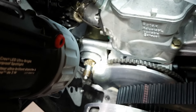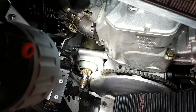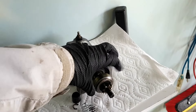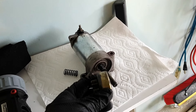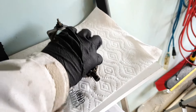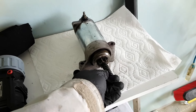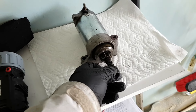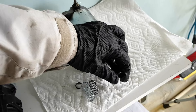You can see a little bit of a shiny buffered area on the main. Here's what the old starter looks like. Before I put the brand new starter on, I had this one. This is the Bendix, this thing right here. A lot of guys suggest that when doing this particular repair, you just replace the whole Bendix. But given that I had a brand new starter, I wasn't going to do that. Anyway, it comes with a spring on it, and then it comes with this cap. The cap partially goes over the spring and holds it in place. Then you push this thing back.